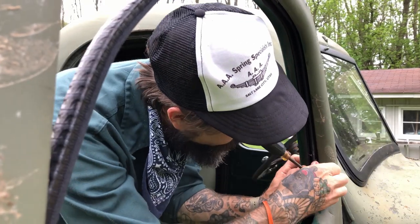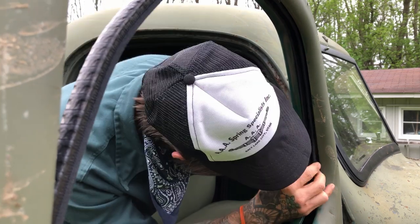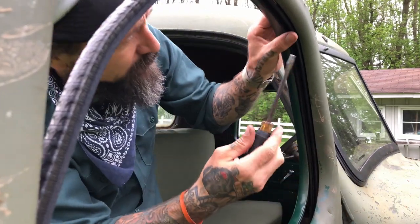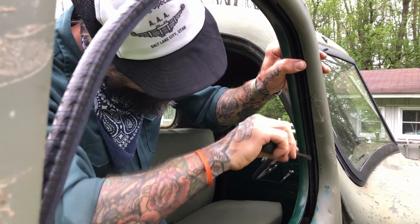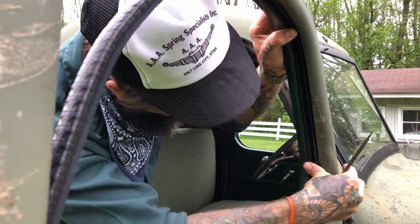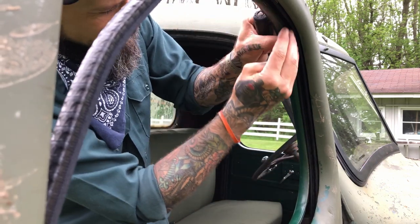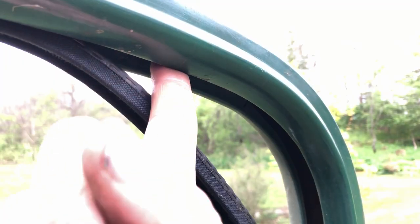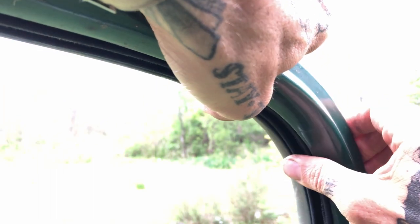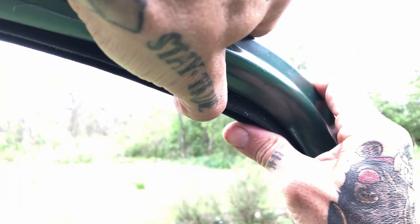This clip is a little off, so I'm trying to get it more centered. I don't really like that — pull it out again because it's pointed a little too much. Push up on the window, reposition it down a little bit, pop it in — and that's what you want right there. Coming down this side, there's a hole here that's seemingly impossible to see. You can mark these with a whiteout pen as you go, but just putting the clip on and repositioning as needed works really well.